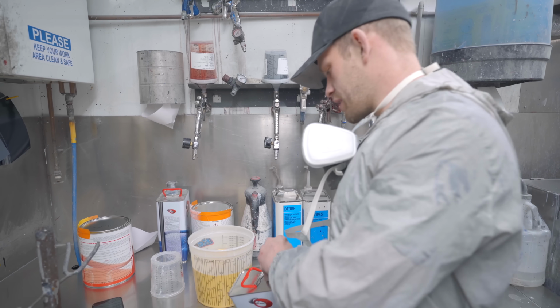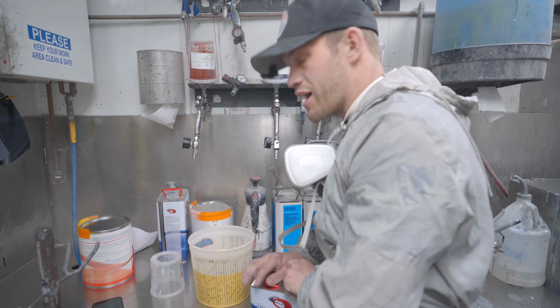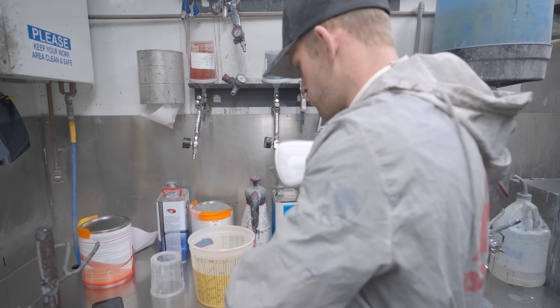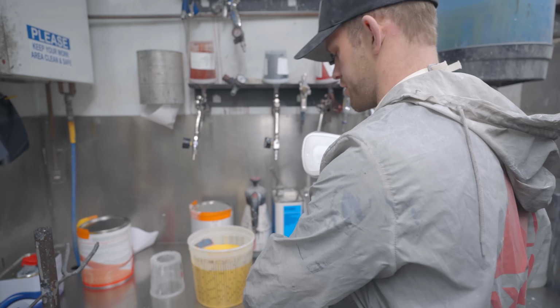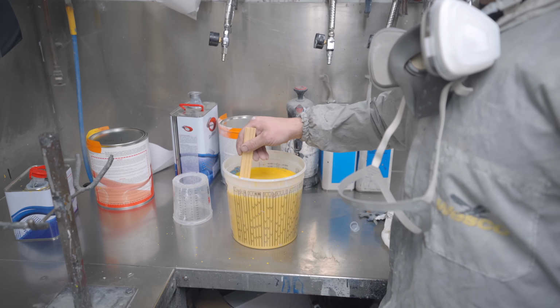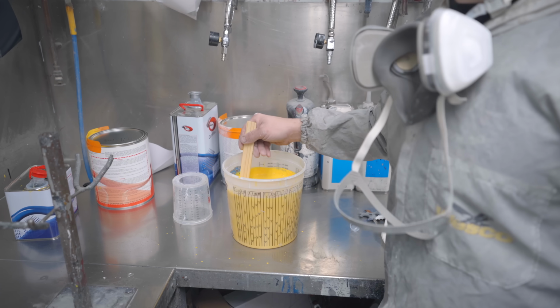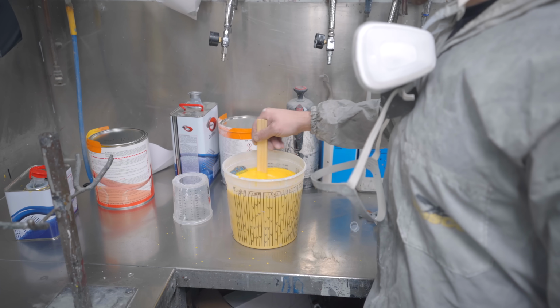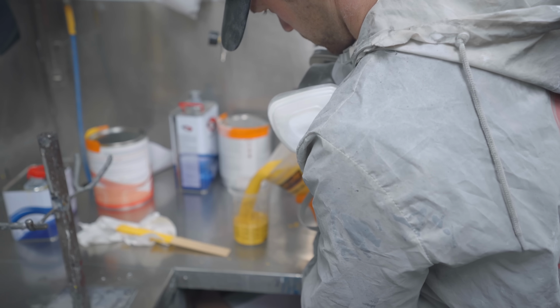So in between the sealer and our first coat of color, we only have an hour. We gotta get moving. 2 parts of color, 1 part of hardener, 10% reducer. And once again, this is single stage, only going in the bay, the inside of the cabin, inside of the trunk, underside of hood, and underside of trunk as well. The rest of everything is getting a base clear.